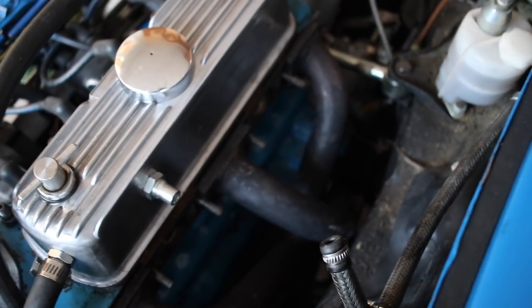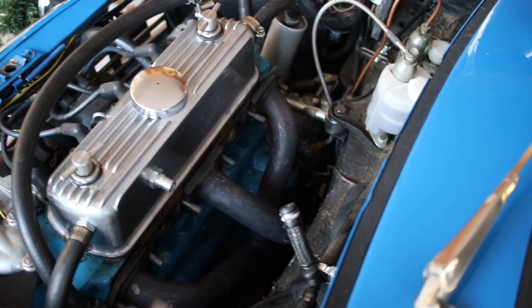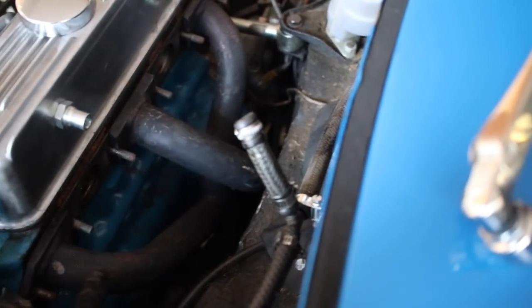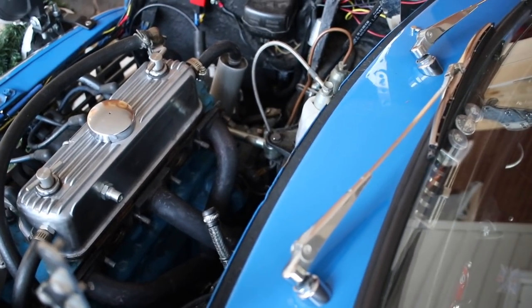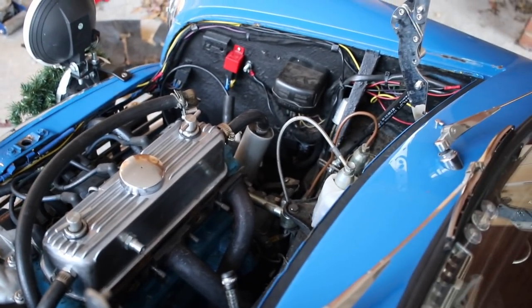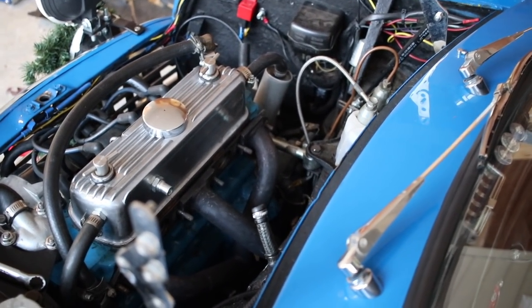With the intake off, the back of the motor looks something like this. I've got a free-flow exhaust on there and put an exhaust manifold coating on it, but that didn't hold up — it's a bit rusty. This is where you can see how your intake and exhaust work: exhaust port, exhaust port, exhaust port, and then two intake ports. This is unusual compared to modern cars — it has a 3-2 exhaust-intake system. The middle exhaust actually shares the two middle pistons, whereas the two outside pipes each have their own piston.